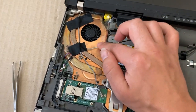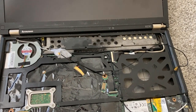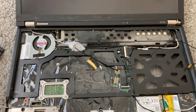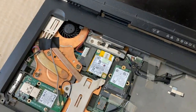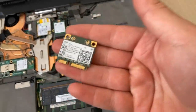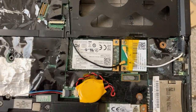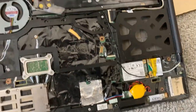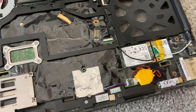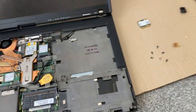There's an alternate routing for this antenna cable to just get there. And I warped the fan heatsink a bit, so the fan stops making noise. What can I say? I'm resourceful. I make do with what I got. That cable's going that way, that cable's going this way. I'm thinking I'm going to throw this wireless N into the X230, because this is running Windows 10, and starting from Windows 8 up is the first Windows that supports Wi-Fi 6. Wi-Fi 6 just does not work on 7, but I like 7. I'm probably going to put 7 back on the X230. So I'm going to throw wireless N back in here just for legacy compatibility. I don't like 10. 10 sucks.